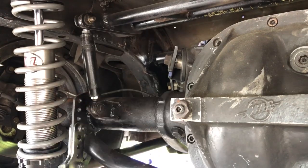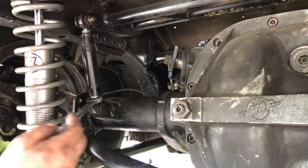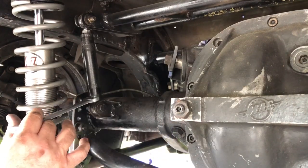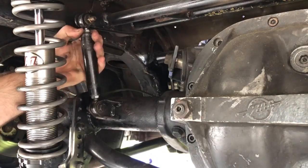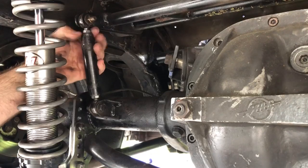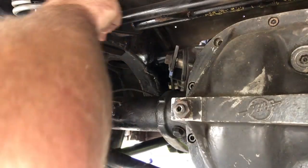When you're setting it up initially, you do want to have somebody sitting in the car, and usually I set it up neutral. And then when it sets up neutral, if it steers one way or the other, then you adjust the preload. But for the purpose of changing it, it doesn't matter if anybody's in the car or not, because you know you're changing it a set amount.